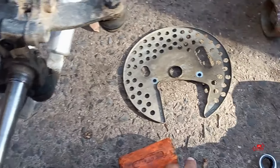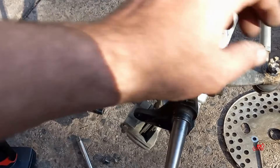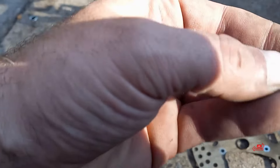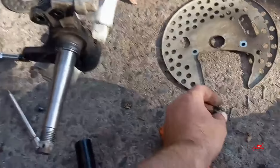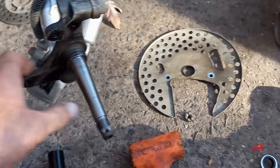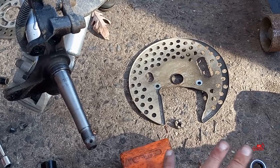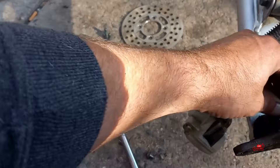I had already taken out all my cotter pins. These came out pretty good — almost like working on a brand new bike and this thing's a 1997. It still has the factory black or olive drab zinc on it. Pretty happy with the condition of this bike even though I blew it up. Never reuse cotter pins — they're cheap, always put a new one in. Once they get bent around they really do serve an enormous responsibility on these castle nuts. You don't want any of this stuff coming loose when you're out riding.